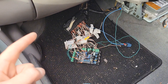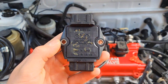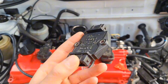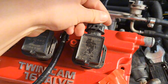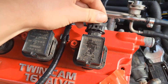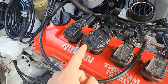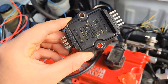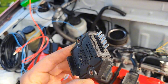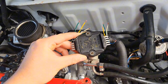Now that that's in I could load the firmware onto the Arduino, but first I want to install this — it's an external igniter from a 1998 Volkswagen Passat. Although these are three-pin coil packs which you would expect to be smart coils, they're actually not, so that's the reason we need that igniter. I've got all four wires cut and since I don't have the connectors I've just cut off the plastic cover and I'm going to wire it straight into the loom.